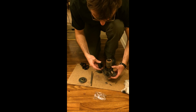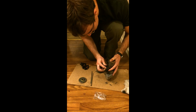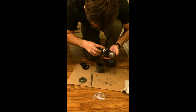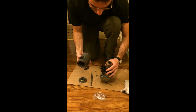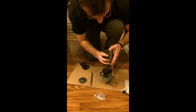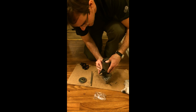Okay, put the dust cover on here, and this is going to go this way. This is going to keep this all nice and fresh, so I'm going to make sure I get it on there well, all the way around. Okay. Now I'm going to lower this housing down onto here. I'm going to keep downward pressure on this because the magnet's going to try to pull it out. So with downward pressure, I just slowly guide it into place.